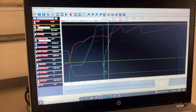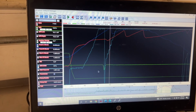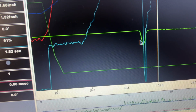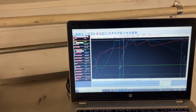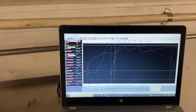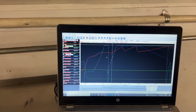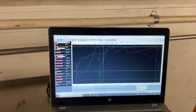All right, guys, got the data log pulled up from that 455 pass, and it looks like Jackstan pedaled it. So they're doing a little bit of footwork. He did pedal it. It actually restarted the nitrous ramp again, which is this ramp right here. So it re-ramped the nitrous. So that actually could have been faster. So we're going to leave the tune-up exactly how it is. We are not going to touch anything because it was perfect going down.